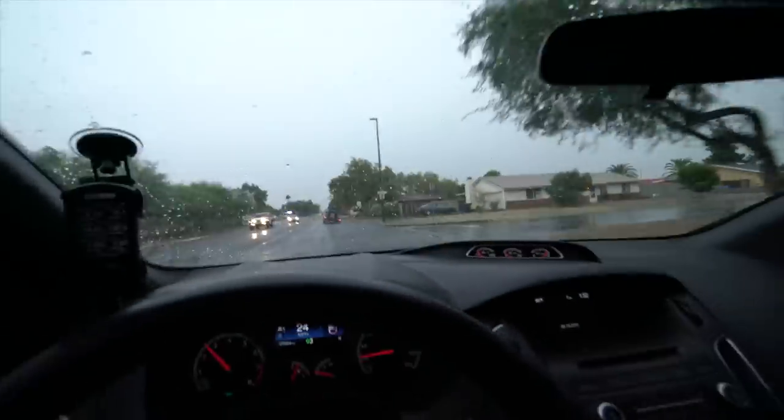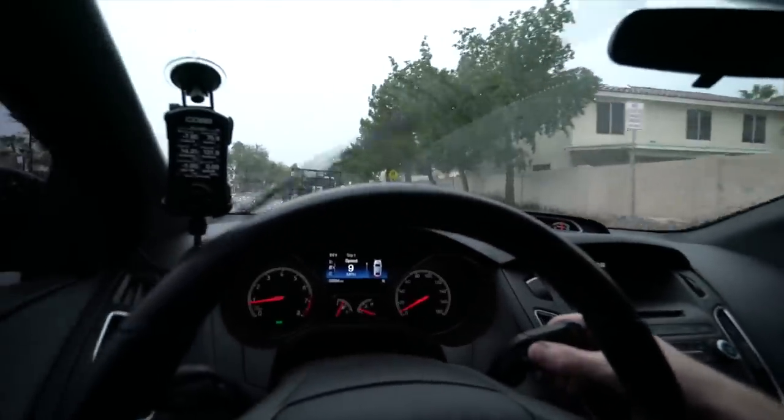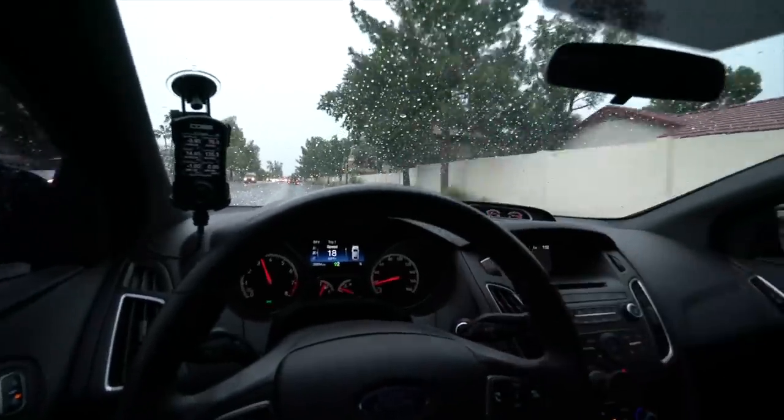Obviously we're going to be careful first because your pedal is really not going to be there after you push the brake pistons back in. These grab pretty hard already. You can hear the pads on the new rotors — because they're fresh, they have that black coating on them. It sounds like something's broken, but it's not. First time driving in the rain in the ST, and the windshield wipers are interesting. Brake test in the rain — they feel really, really good, and then when you're about to come to a stop, they just — you can't really explain it over a video.